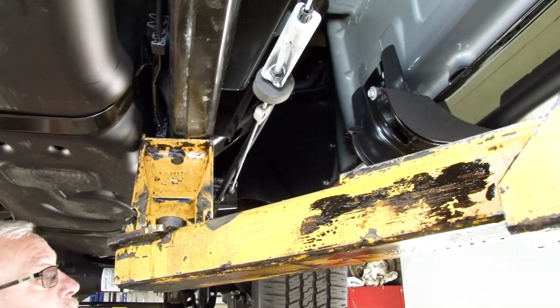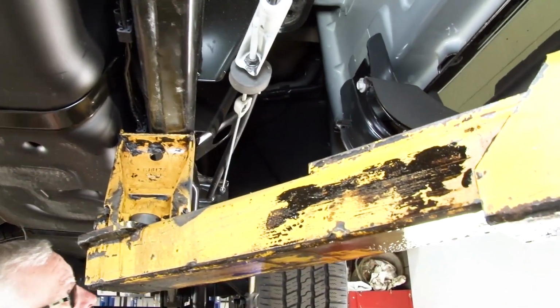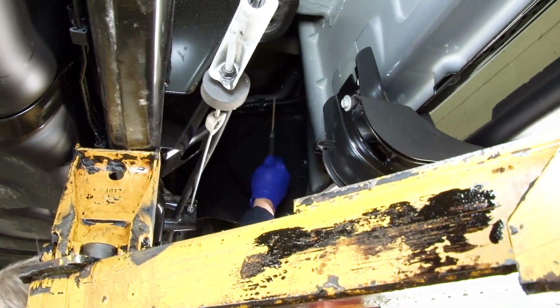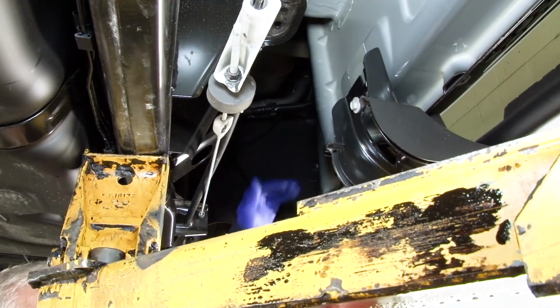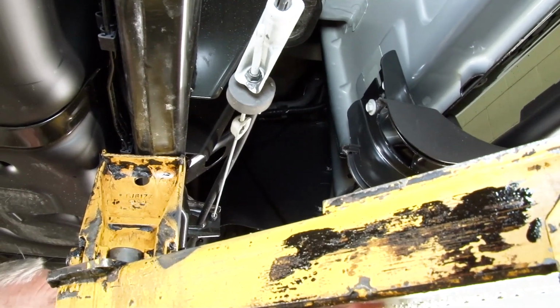On pickup trucks, we're going to treat the bed sides by taking the rust proofing and the short wand, reaching up, spraying up over the wheel wells, and spraying a complete bed side until we're about a foot above the bottom of it. The rest of it will be sprayed with undercoating.